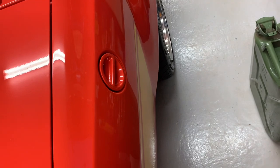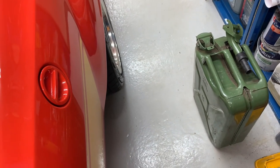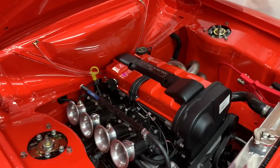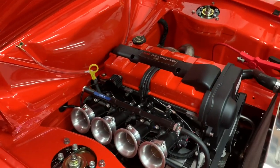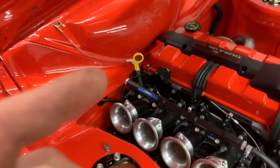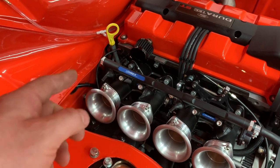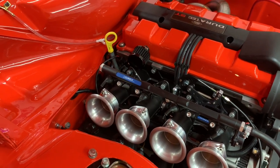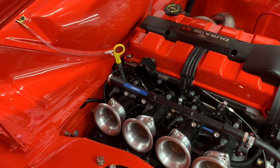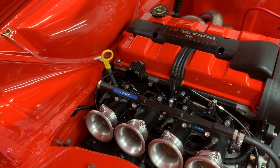You know you're getting close to firing a car up when you get to this stage. Right, a little bit of an update. Put the fuel in, touch wood, there's no leaks on the fuel system. But what I have just done is I've undone that blank on the end of the fuel rail, put a rag under it, and ran the fuel pump. It took two, because when you turn the ignition on, the Omex ECU primes the pump for maybe 2 seconds or so.